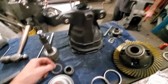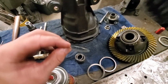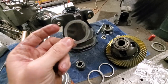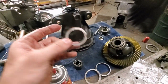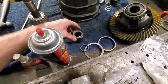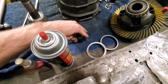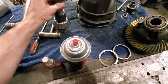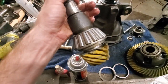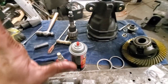Going back to the two spacers: we also have a shim from a 9-inch rear end shim kit - it was the smallest shim we could find - something that Sean had in his shop that we put on top of the meatball. Then we put the thick spacer on top of that, place that on the pinion shaft, and that is our complete setup for the pinion shaft.